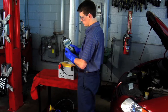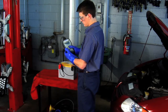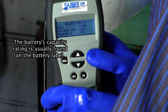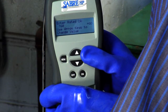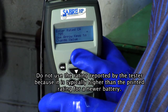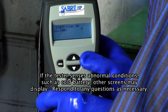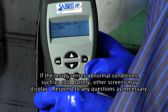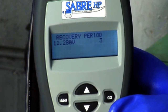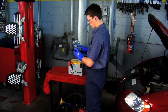Press the Go key. This displays the Select Unit screen. Use the down arrow key to select a capacity rating for the test. After selecting a capacity rating, press the Go key. This displays a screen for entering the capacity rating. Use the up and down arrow keys and adjust the rating until it matches the rating on the battery's label. Press the Go key to begin the Load and Recovery part of the test. The screen displays first load on, second load on, recovery period, and then working, as it applies two medium loads to the battery, followed by recovery periods, and then determines the battery condition.